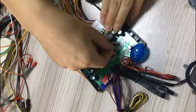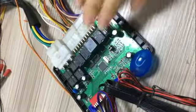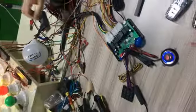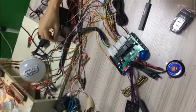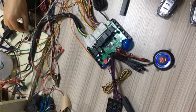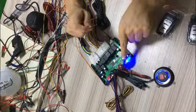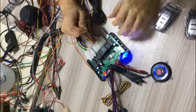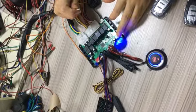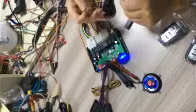Insert back to the original position — pins two and three. Now start again. I also use this cable to touch the ground. Yes, you will hear the siren make a big sound and this alarm LED blinks rapidly and fast. It means now it is in running status — smart anti-hijacking running status.